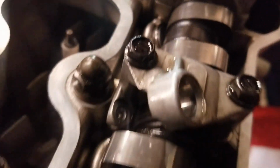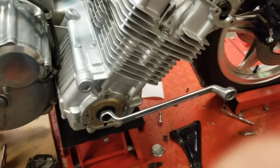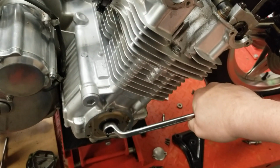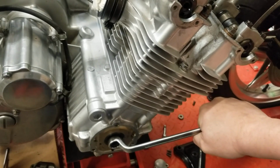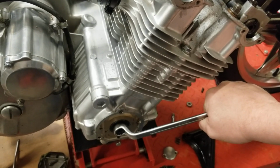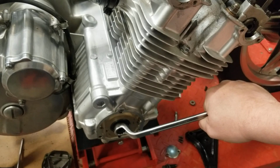And when I go to loosen it, I'm going to show you what we'll do, and then we'll watch that. And if this thing needed adjustment, that's going to pop up. Maybe as little as 1/8 or so of an inch, but that's plenty when it comes to how much slack it's taken up. So the procedure goes like this. I'm going to stand over here, and we've got a 17mm box end wrench sitting here on the crank end. So I'm going to put pressure. I'm going to really be acting like I'm rotating the crank, which is going to put all of the slack to the rear where the tensioner is. It's going to take up all the slack on the front, and the tensioner sits on the rear.